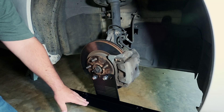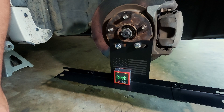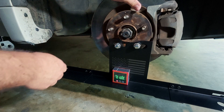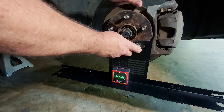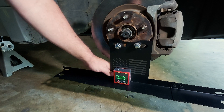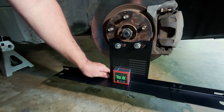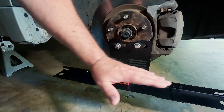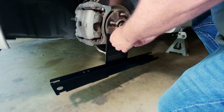This right here is where the angle reader will come in. I'm going to turn the angle reader on now. I need to rotate this until it reads zero. Now I know my wheel is perfectly level with the ground. I'm going to go do this to the other side now. I do have my car in neutral, by the way.